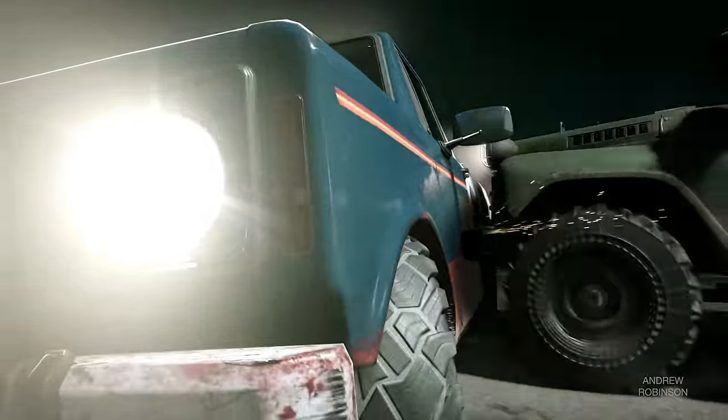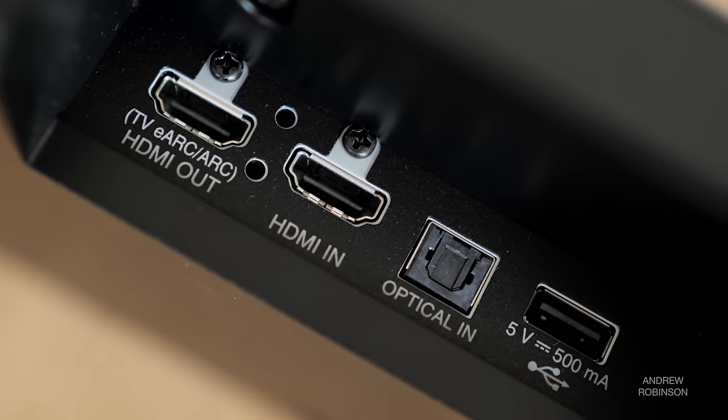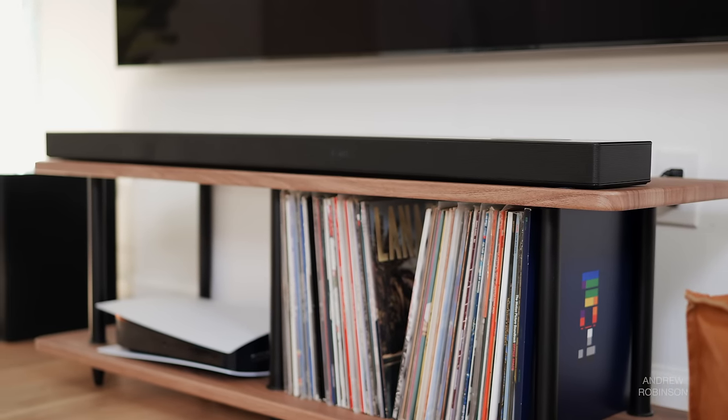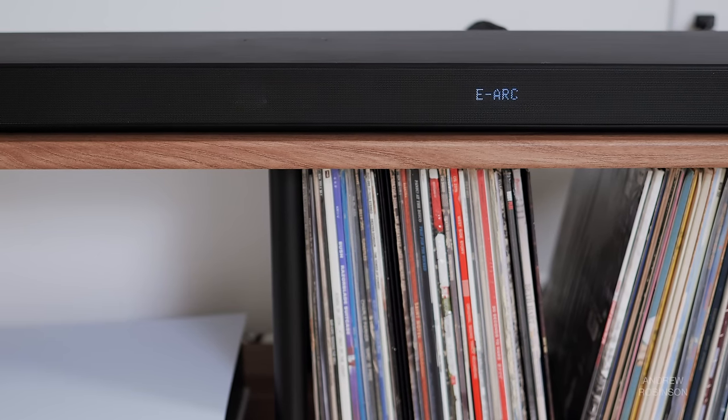I tested gaming through the LG using the additional HDMI input. When connected to my PS5, Call of Duty was great and passed through in 4K 60 HDR, but sadly no 4K 120, at least not in my experience. If you want to enjoy faster frame rates, you can always plug your console into your TV, then go HDMI eARC out of the TV into the bar. If you're using a regular Blu-ray player or video streamer such as an Apple TV 4K, you will have zero problems. The eARC functionality worked flawlessly on the LG. In 2021, having functioning eARC should be automatic, and yet this isn't always the case. Dolby Atmos signals coming from Netflix or Disney Plus registered automatically, and because the LG has a front-facing display, you get visual confirmation of what you're listening to.